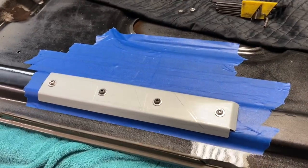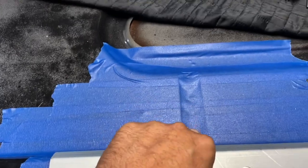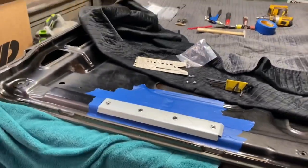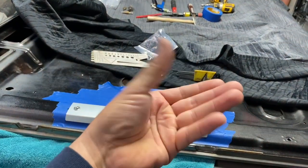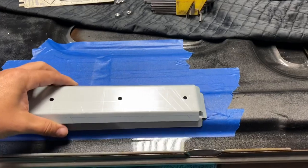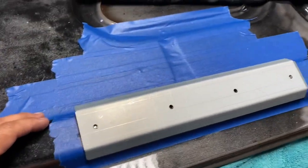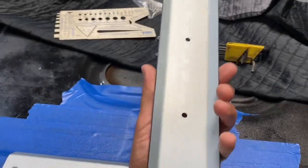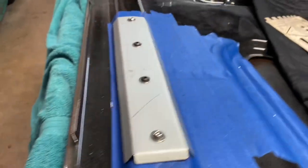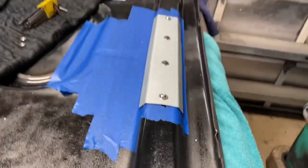And what this does is actually comes along this edge here where there's a fold, and this is typically where your hood ends up tacoing. So it's gonna do that. So this brace is laser cut, it goes right on there. I actually went ahead and squeezed these in a little bit to make them even tighter so they contour exactly. And they look a little bit more discreet.